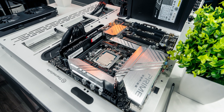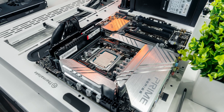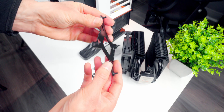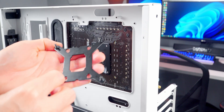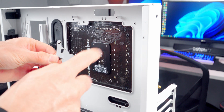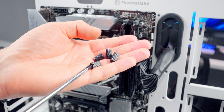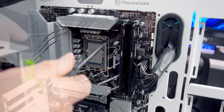Starting the installation with the Pro 5 on LGA 1700 using an Intel Core i7-13700K. First, get the Intel mounting back plate and insert the posts into each of the four holes — this supports multiple Intel sockets with different alignments depending on which socket you're using. For LGA 1700, it's the outermost location. Then slide it into the back side of the motherboard into the four holes. If you set the posts up properly, it should just slide in effortlessly. On the other side, take the little screw posts and go around one at a time screwing them down onto that back plate.